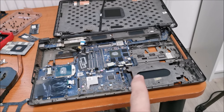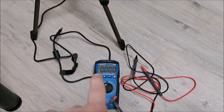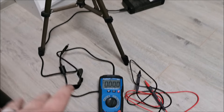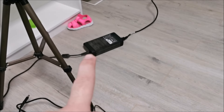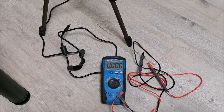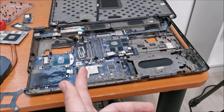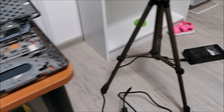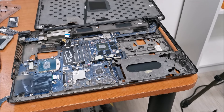Whatever shorted inside of this thing actually put it in protection mode — it wasn't outputting any voltage anymore, and I don't think it has a standby. It was just absolutely zero. So I unplugged it, plugged it back in, and now it's outputting 19.5 volts. So maybe no protection — this thing blew up and then the charger said hey, I'm cutting it. Anyway, I'm taking the motherboard out and looking on the other side, then cleaning all the corrosion all over it, putting everything back in, and without connecting anything to the display, seeing if this thing can still power on.